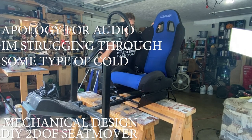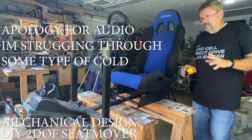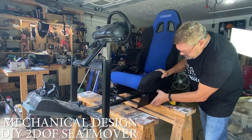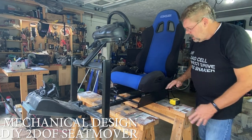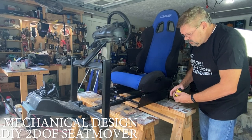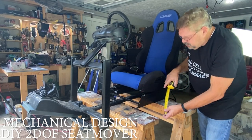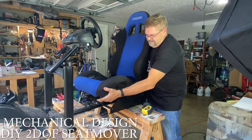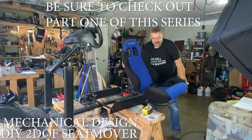For right now, what we need to do is make a stable base. We'll take the seat off and have this area to play with — it's for mounting the U-joint and the motors, probably in the back. It looks like we've got about four inches to play with, so let's get that seat off. She comes right off — this thing is still pretty heavy.